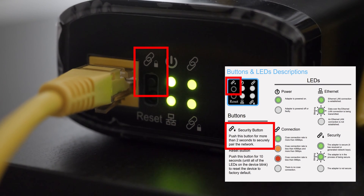The top button to the left of the power light is your security button. When you've connected everything, powered it up, and let it go through its boot sequence and it's all working for the first time, you can hold down the security button for two seconds on one unit and the security light will start blinking. You then have about two minutes to get to the other adapter and press its security button for two seconds, and it'll start encrypting the signal between the two. This can take a moment, so just be patient while it does its magic.